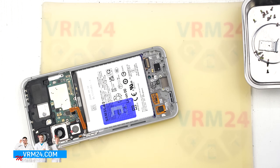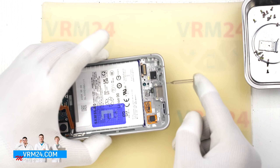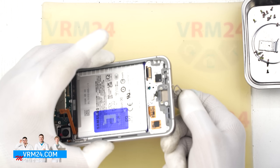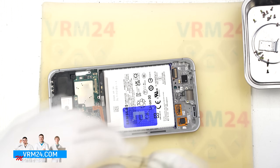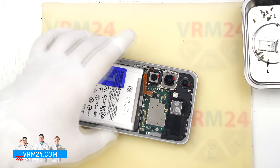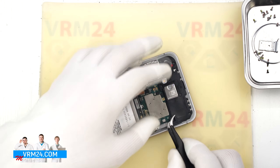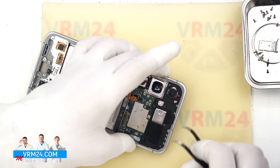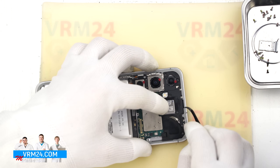The fingerprint sensor and vibration motor remain in the display frame. Now a quick check of the microphone opening — the microphone hole is located in the display frame and has an L-shaped design. On the back side there is a gasket or membrane, and the microphone itself is positioned on the subboard on the opposite side. So if something is inserted into the mic hole from the outside, it won't damage the microphone.